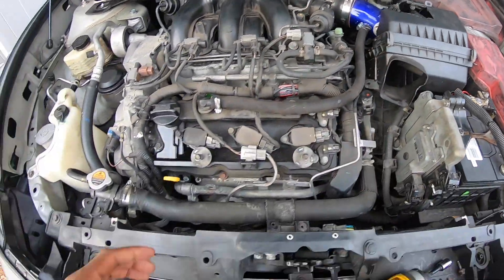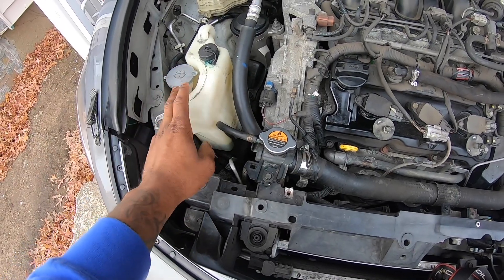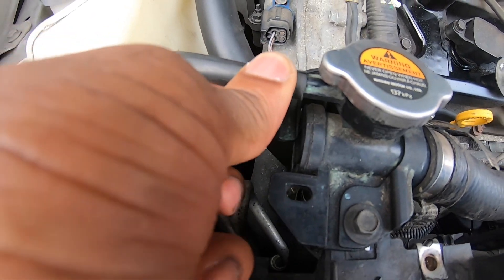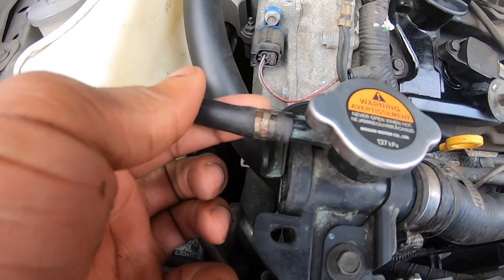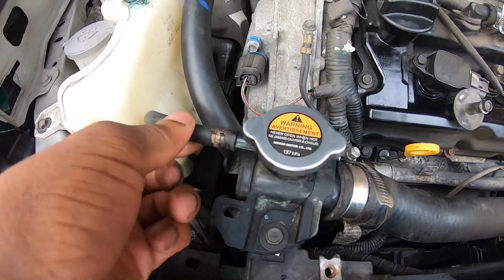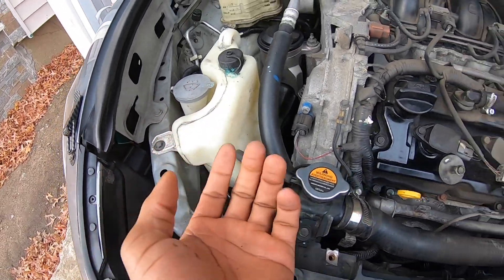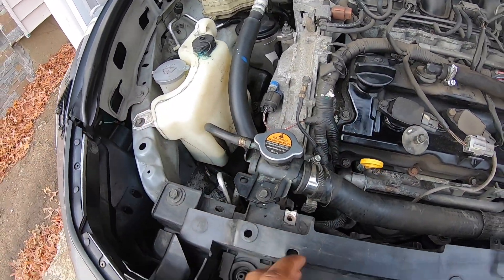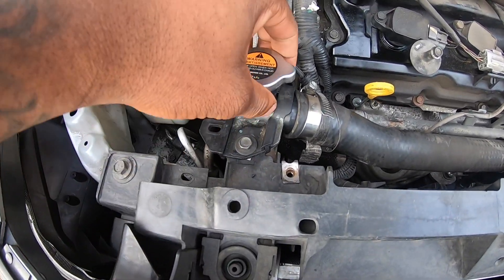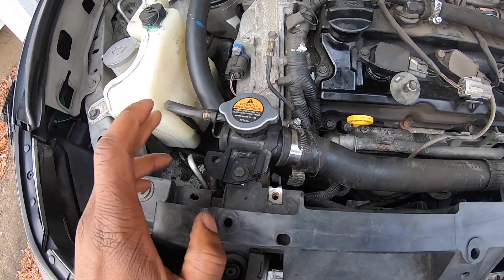After that, you're going to take out the reservoir too. You'll need needle-nose pliers or whatever you call them — take this clip off. When you move the clip, put the pliers in and twist. There's a 10 millimeter screw — it's not going to drain the fluid, just set it to the side on the ground. After you take this off and pull it to the side, you want as much clearance as possible.